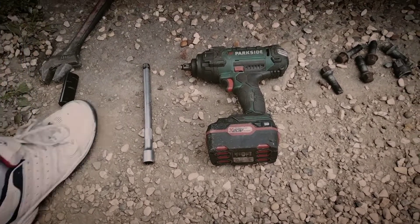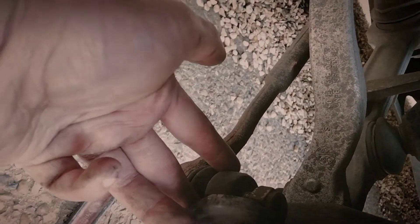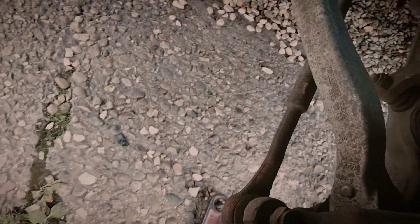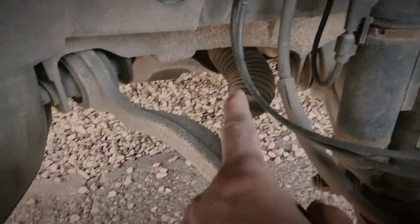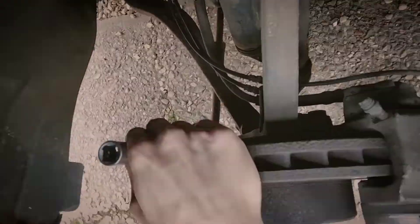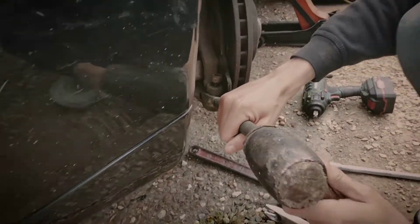Let's get a big hammer and a bar. We've got the nut up, so what we've got to do now is get the ball joint split. There's a fork that goes under that piece of metal and then pushes down with the bolt onto the threaded part of the ball joint and pops it out. We've got a pile of new bits there to fit, though I'm just a bit concerned as to what hides beneath that boot.